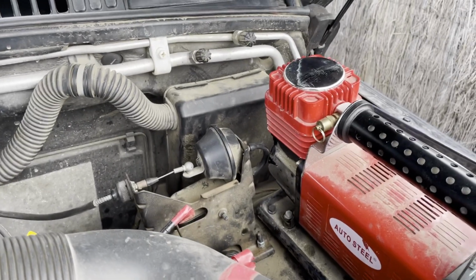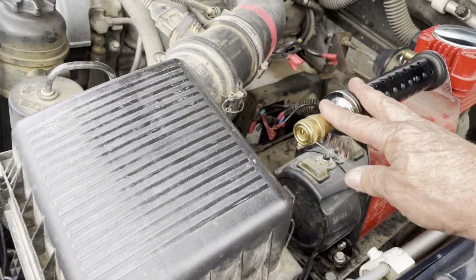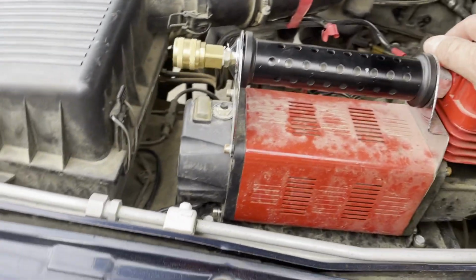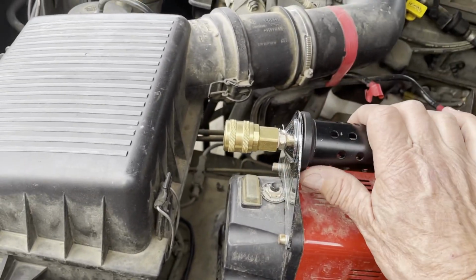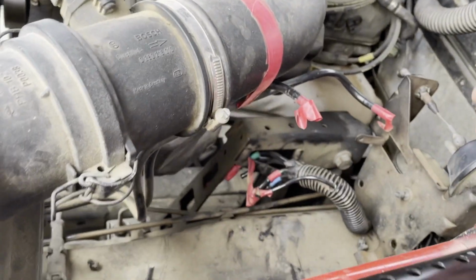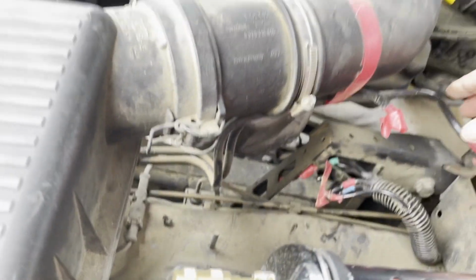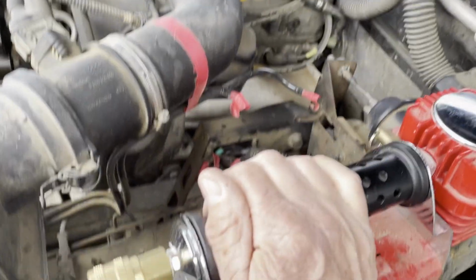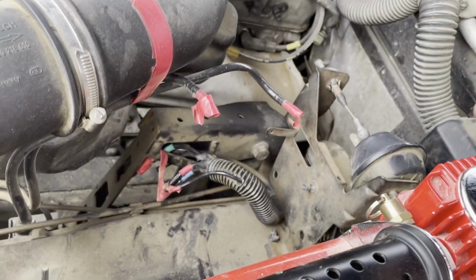Now on this side, because it used to have air suspension, I've taken the air suspension compressor out, and the valve block. The valve block used to go in here, and I've replaced it with this cheap Chinese pump compressor. It goes up to 250 psi or something ridiculous. Got no regulator or accumulator or anything on it. I do still have the tank from the original setup connected to all these pipes down here, which would be very easy to connect to this, but I just can't see the point. I just don't need it. You very rarely use this. It's only for airing your tyres back up after you've been off-roading, and on Sarge as well. That's why I've got the long hose, so I can do Sarge as well. So I just bolted that in there.